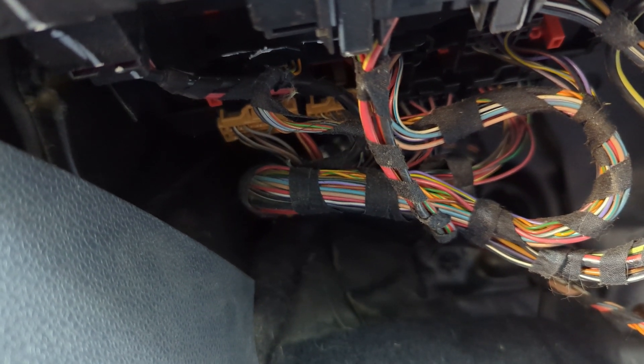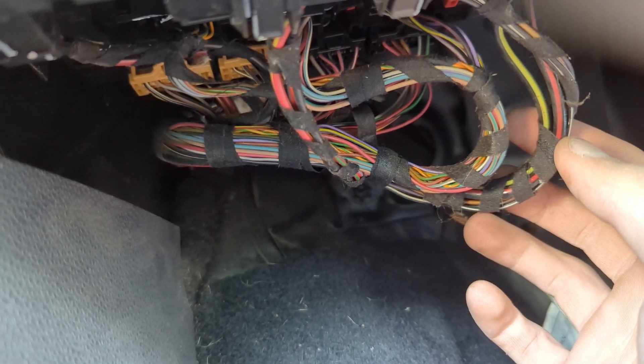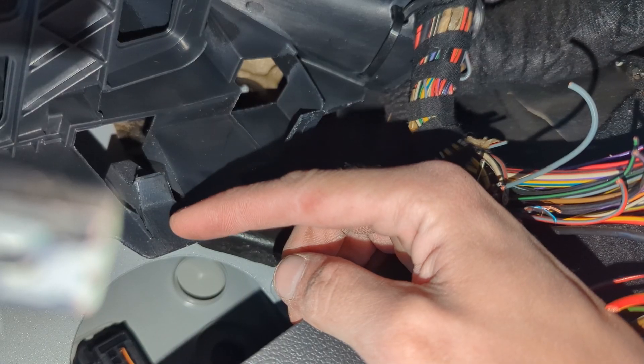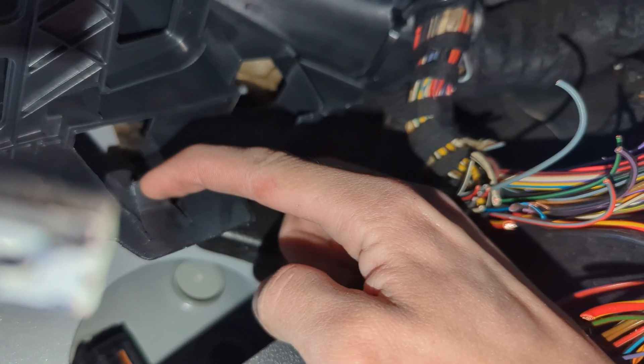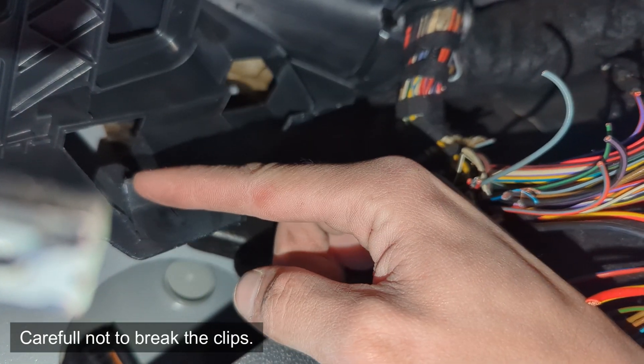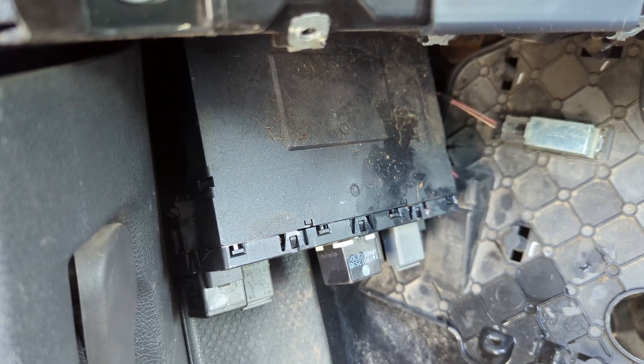There's going to be a tab on the right and the left side and you push them outwards. Then once you push them outwards this module can drop down. This here is the right side — these clips act like a one-way door, so when you slide the module up it sits on this lip. When you're trying to get it out you have to push outward; there's one on each side. You can now see that the module's dropped down.